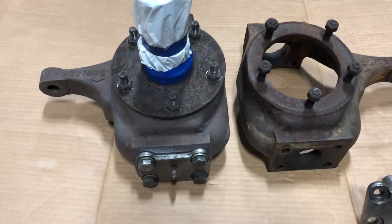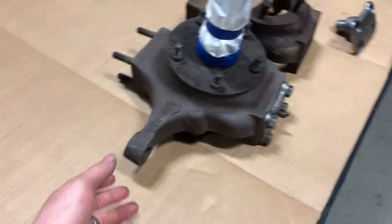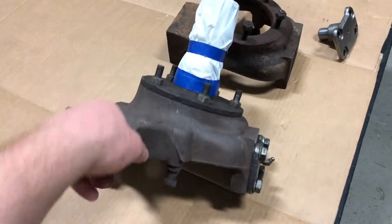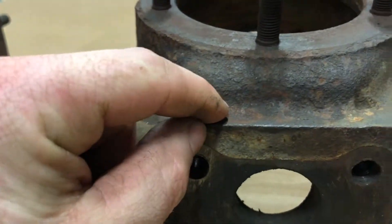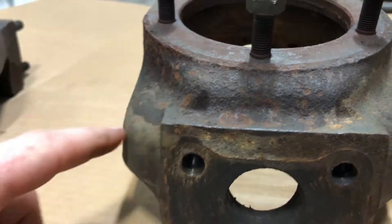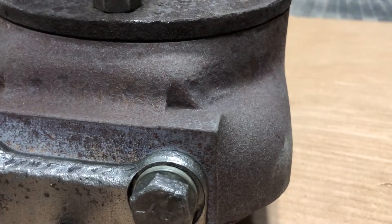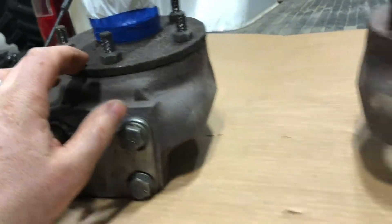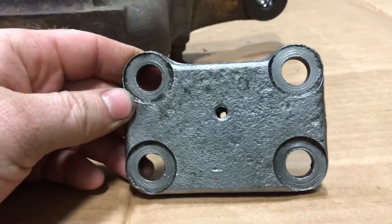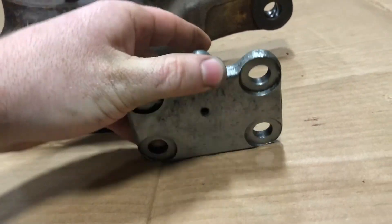Today I'm going to paint this whole knuckle assembly. I had soaked it in sodium carbonate and water, then used a battery charger — electrolysis — which really got rid of the rust scale. I pressure washed it and then primed it. For the spindle parts, I soaked them in apple cider vinegar and water for about three days.